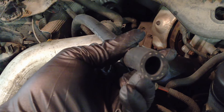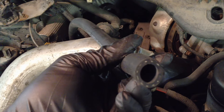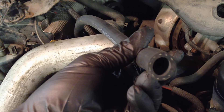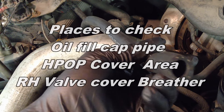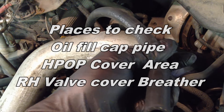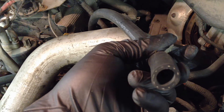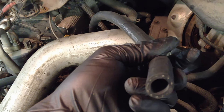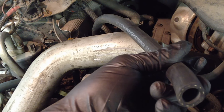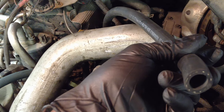I heard the IPR moving — there's a high-pitched noise when I command it — but zero air noise change. So on this one I'm going right after the IPR. This truck has over 200,000 miles on it and it's the original IPR. IPRs don't fail that often, but with the miles on it and the customer mentioning a high pressure pump was recently replaced — including the snap-to-connect fitting — and it's been running ever since, the IPR is definitely original. We're going to swap it out and retest.